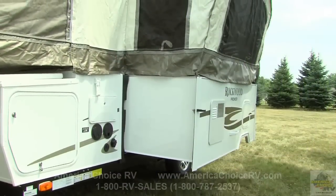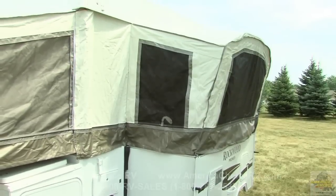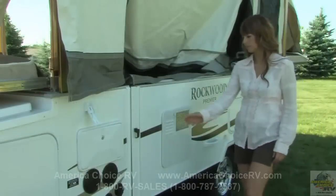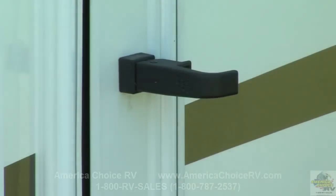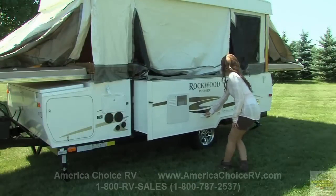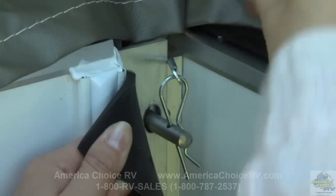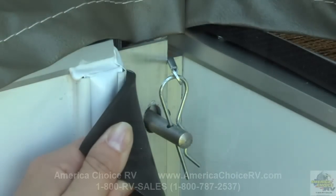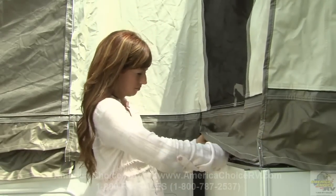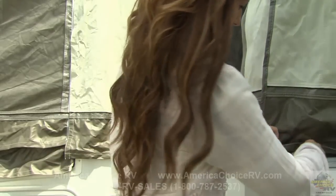See your owner's manual for more information on how easy it is to clean and maintain your tent for years of enjoyment. If your tent camper is equipped with Rockwood's EasyGlide slide-out dinette, there are a few additional steps. Release the slide room by lifting the lift and turn latch, then turning to release the lock. Take hold of the handle and pull out the slide room. Attach the cotter pins to the steel pins extruding from the sidewall at the seal. Rockwood attaches the tent material to the slide-out, so simply attach the Velcro strips to both sides of the slide-out.